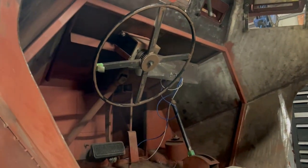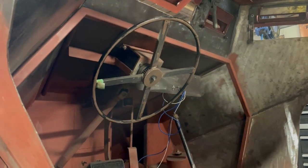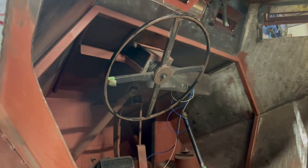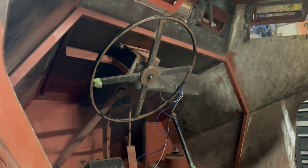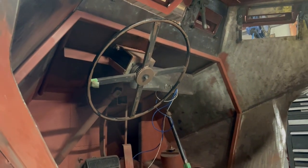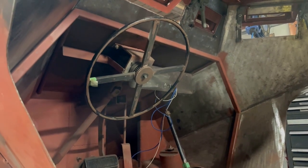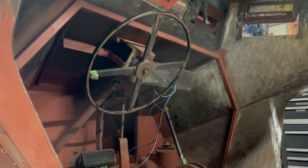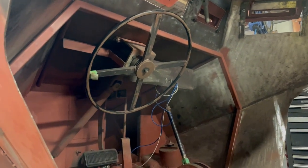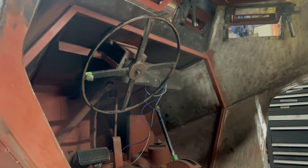Obviously the steering works. I've got that ATV gearbox in there to get the 90-degree orientation, but I, at the time, thought that was a 1-to-1 gearbox, but it must not be, because this steering is crazy. It's like a yacht. It takes a lot of turns of the wheel to get the tires to start moving. Obviously, it is drivable, but when you're trying to maneuver, do 3-point turns, sharp turns, this thing is hard to drive and it takes a lot of practice.